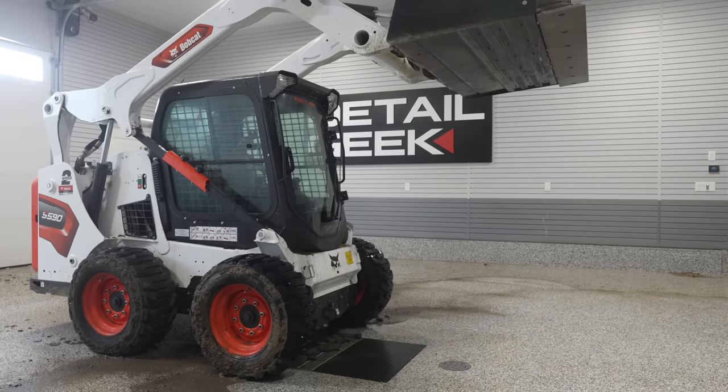Okay, now as I finish up with the pre-wash rinse here, I'm going to go ahead and lift the cab this time so I can spray out underneath it as well. And that involves putting jack stands at the back of Bobby, because safety first, guys. And then there's two bolts inside the cab, so with those removed, I can just lift the cab up until it locks in place.